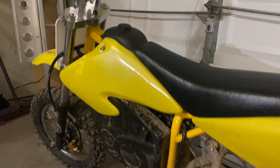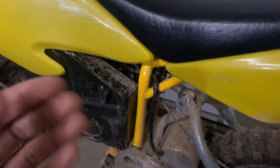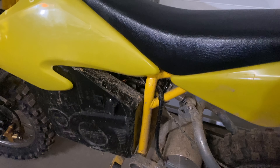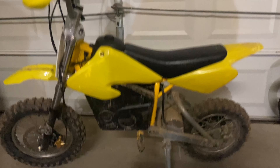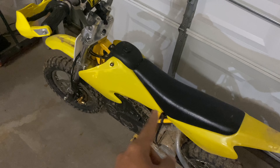Please excuse all the dirt - this bike is still caked in mud, I haven't had time to clean it. The main thing I want to change is this rear shock - it is garbage. The dampening is basically non-existent and the spring rate is way too high. I only installed it because this bike started as a budget off-road project. We're definitely going to be swapping that out with a DNM air shock, a 190-millimeter one. I don't think I need 200 millimeter since ground clearance hasn't been an issue - I just need it to be a lot more comfortable over bumps.